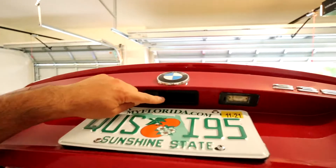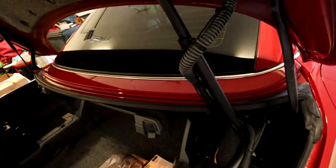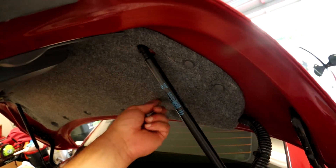You can see I'm sitting in the trunk. We got some other projects to do. We got to repair the broken stuff from when we put in the multimedia. The backup camera does not work, and I believe it's because I did not ground it. I have this wire here — this is not the ground, this is the video cable. So behind here, tied up, is a power wire and a ground.